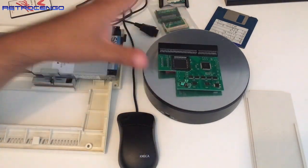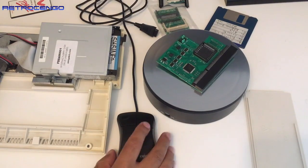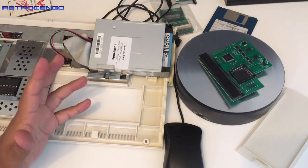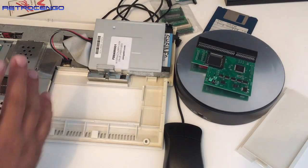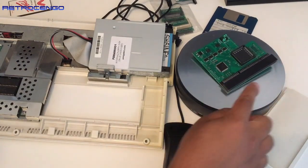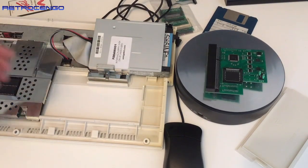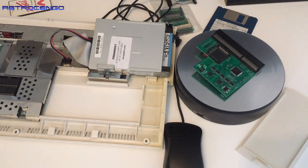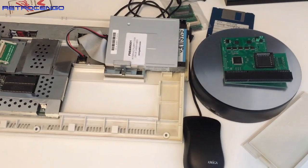Before we install this, I want to say that this RAM card is absolutely cheap and a must-have for your Amiga if you want to play WHDLoad games, because the built-in 2 megabyte chip RAM is just not enough on its own - you have to minimum upgrade to 8 megabytes of fast RAM. However, these black sockets are really just too thick to go in easily. You can get them with white connectors which are a bit better, but still too thick.